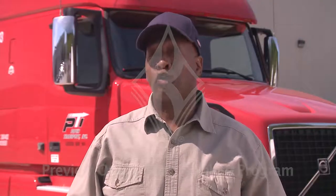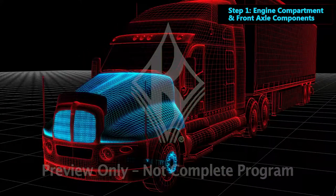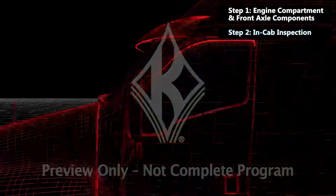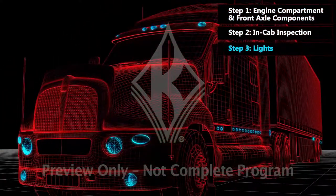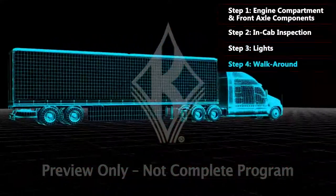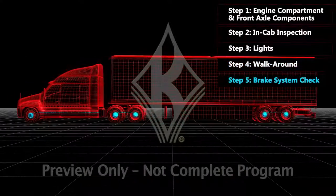A pre-trip inspection covers the entire vehicle with a five-step process that takes you around your tractor trailer in a logical order. You'll start in the front for step one, where you'll inspect the engine compartment and front axle components. Step two is the in-cab inspection, and in step three, you'll check the lights. Step four is the walk-around, which will always be the most time-consuming part of your pre-trip inspection. Then, you'll finish your pre-trip by checking the brake system, which is step five.